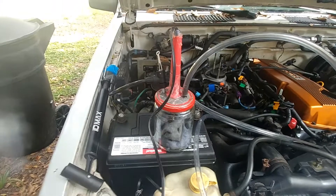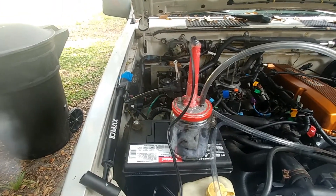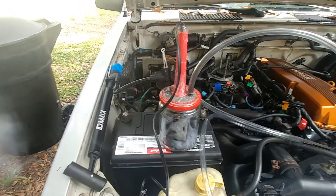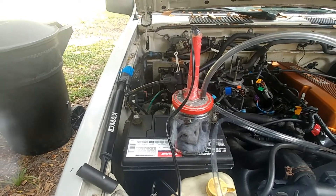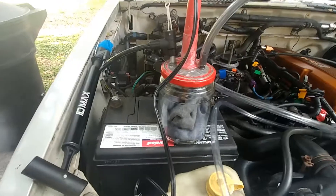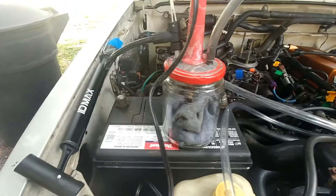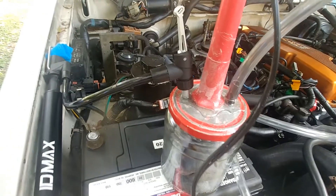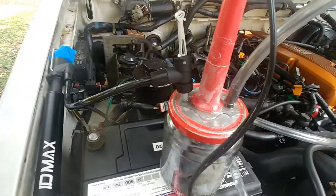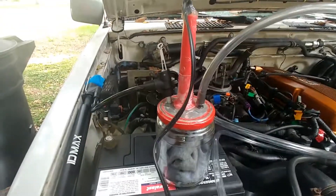Here's my setup for the smoke leak finder machine, as requested by the folks over at Infamous Nissan. This design is taken from a DIY YouTube video on the subject. It's basically a glass jar filled with an old sock covered in mineral oil — aka baby oil — and the lid has three holes in it: one for the intake of fresh air, another to blow the smoky air out into the intake manifold. I'll put a link in the description to the video I used to build this.